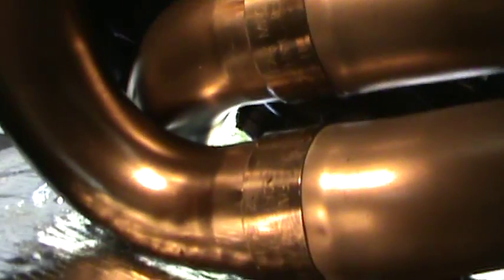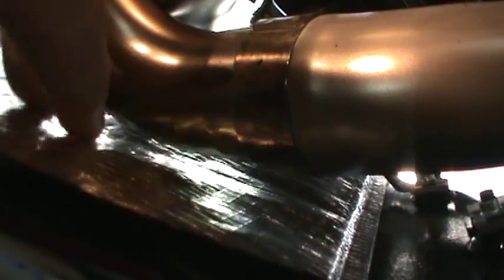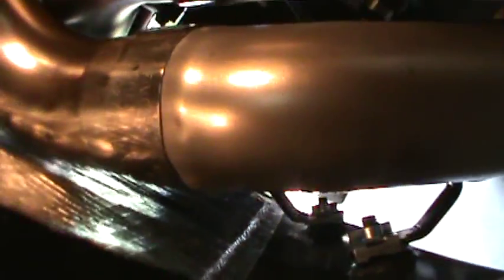I got that clearance by bending the brackets. Swinging around to get a shot of the front — this heat tape will balloon up a little bit. I'm pushing on it and I can actually get my finger in between it and the fairing right now, so I've managed to get a little bit more space. The front bracket is going to be hard to see because it connects right back in here, and I can't even get my finger on it — it's a little bit further down.